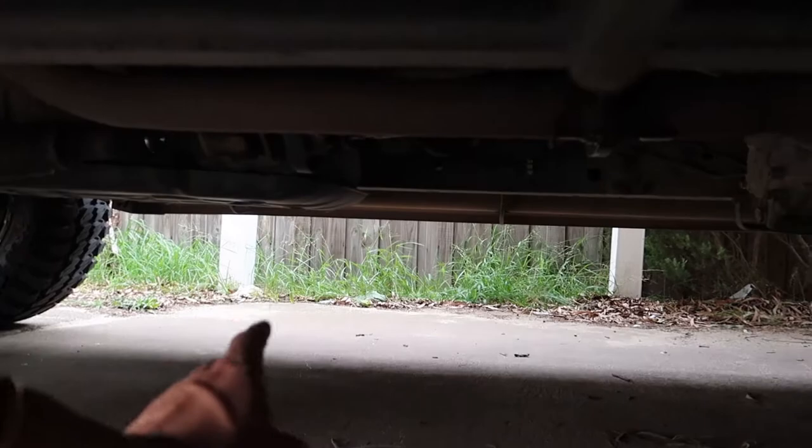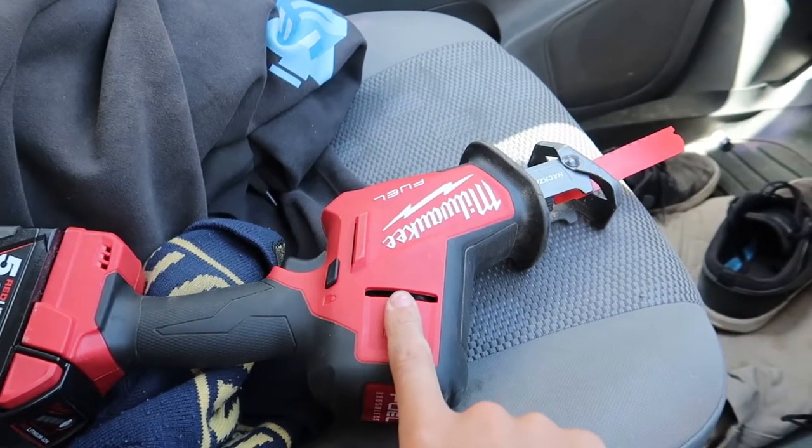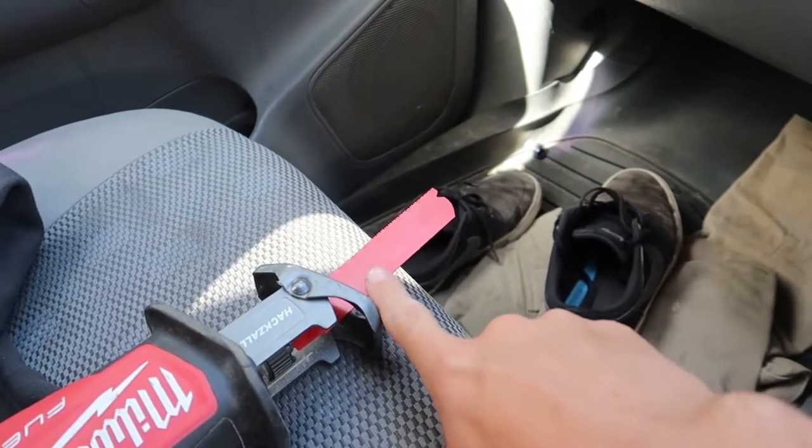If you can't break your nuts loose, you've got to get a recipro saw. If you don't have one, I'm sure one of your mates or your dad's mates has one. Just cut it right here with a metal blade — it will take not even three minutes, super simple. There's a hanger right there so it won't flap around. I'm using a recipro saw with a metal blade because I can't get the bolts off. I could try a bit more, but I already have to take the exhaust off in a couple of weeks anyway when my full exhaust comes, so it's kind of pointless. I'll just cut it and throw it out in the end.